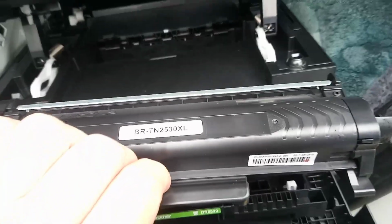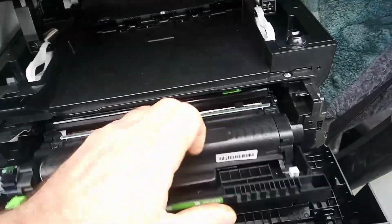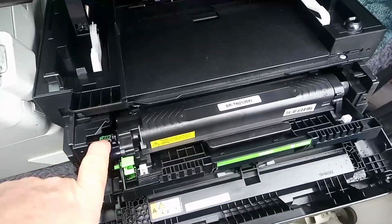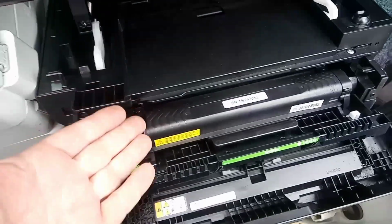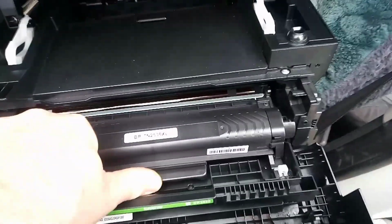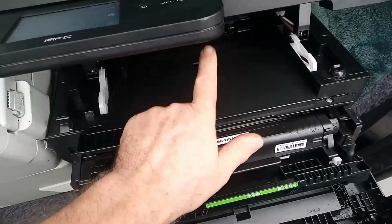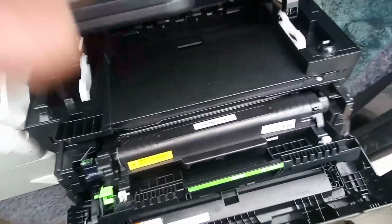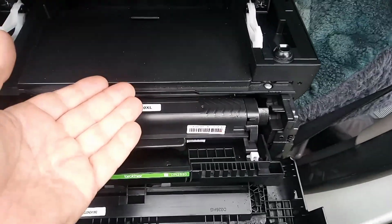So customer buys this non-genuine cartridge, throws this in the printer. The chip may or may not pass straight away. It may be detected as non-genuine cartridge straight away, which then means the cartridge can't be used in this machine, because that 1V1 code gets stored in the memory inside the machine. So if this cartridge gets detected as being non-genuine and the machine rejects it, it could be full, it could be halfway full, it could be 3/4 full, it could be 1/4 full.